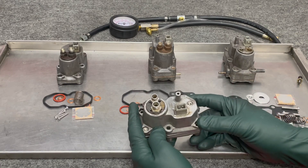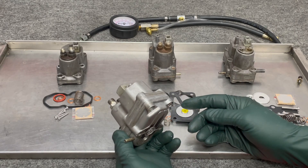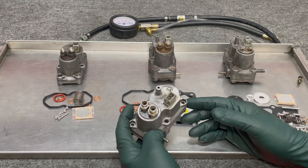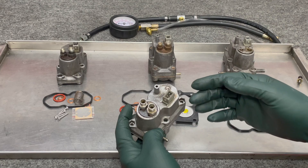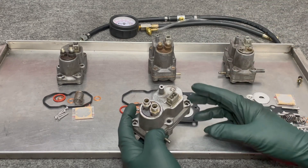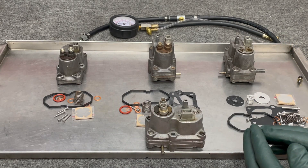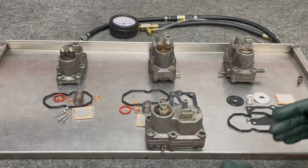When these are not working properly, you can pull your hair out trying to get the engine to run right. And if you don't know what's going on inside or even what this does, it makes it even more difficult. You can't believe the number of emails I get, particularly from people restoring these old 450 and 380SLs. They've changed points, changed wires, changed fuel distributors, changed filters — everything — and they still can't get the engine running. I ask them: what have you done with your warm-up regulator?